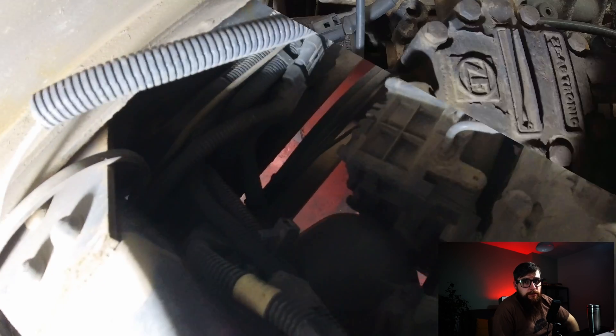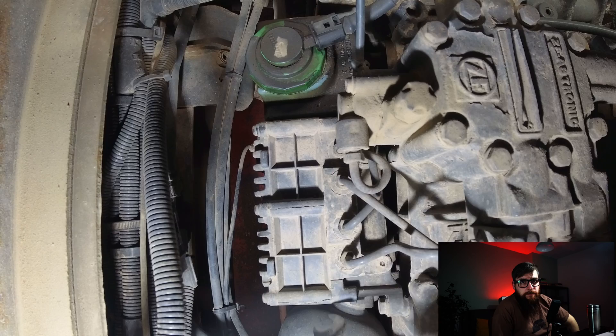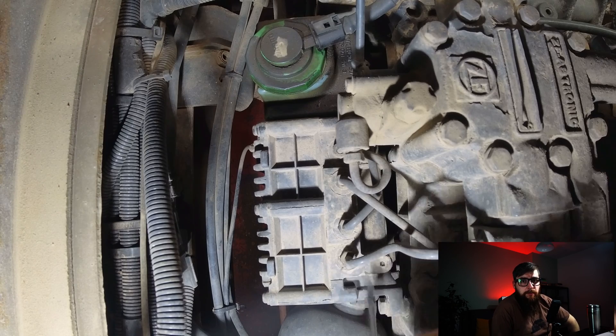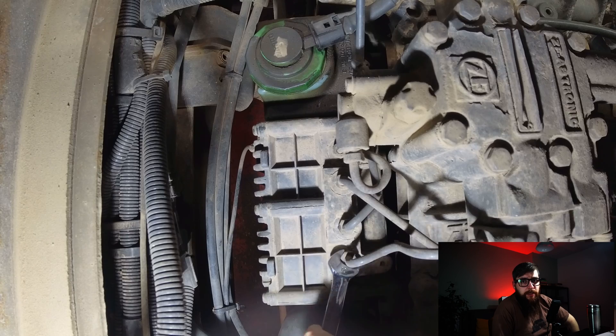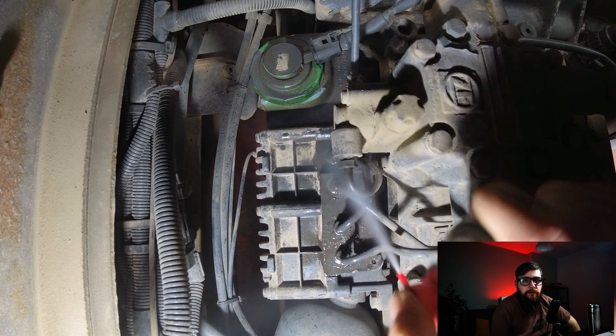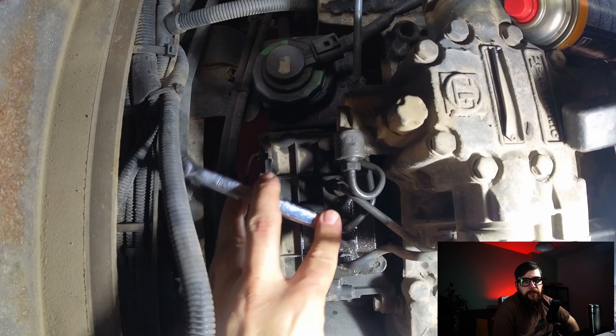It's bad enough I'm trying to do this outside on the flat. It's a scaffolding wagon so I've got really limited access. With me leaning over the cross member and wedged against the prop shaft, I'm blindly trying to get this power pack off for repair. With the union having none of it, I've gone with a brake pipe spanner and maximum effort, but I've managed to round the pipe off even with this. I've decided the gearbox is coming out to do this properly.